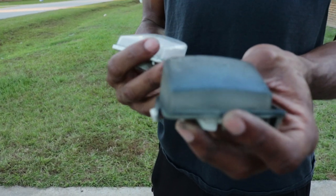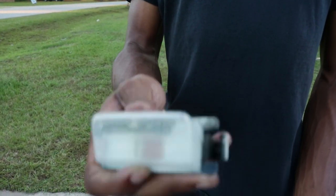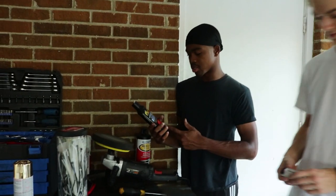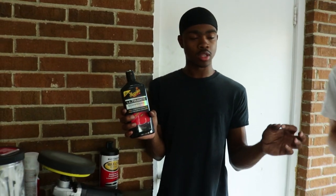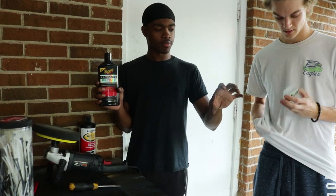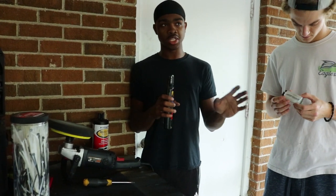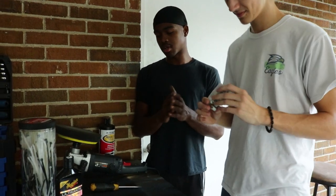This is our before — it's almost not transparent. And now we have this, which is transparent after sanding, before the polish. Next we're going to polish. Right now we are using Meguiar's Ultimate Compound. This is what you want to use to smooth out the fine scratches — not like nail scratches, but the micro-haze. When you use your buffer and buff pad with this compound, you'll pretty much remove that haziness and the lights should look near crystal clear.